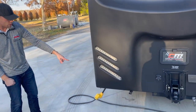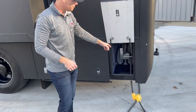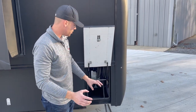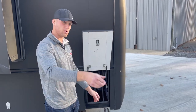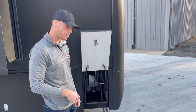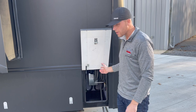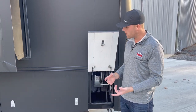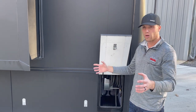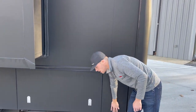The little tip there is your generator exhaust. This next compartment has your shore power reel — it's powered, so you press to release and retract. I highly recommend helping feed the cord as you press the button to roll it up rather than letting the electric motor do all the work. In this compartment you'll also hear a little box humming — that's the automatic transfer switch, which takes generator power or shore power and chooses what goes into your breaker panel inside. If you fire the generator up, it'll choose generator power over shore power. Nothing to worry about.